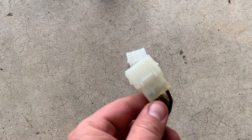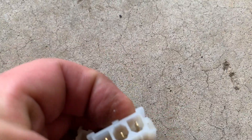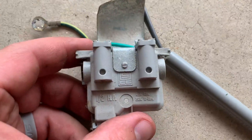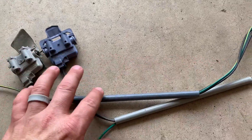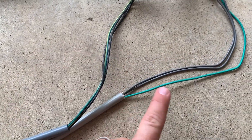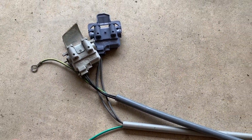Now I'm going to compare my original with the aftermarket one that I purchased. You can see we have three wires with a green in the middle on both of them, and the clips look the same. Down on the other end is simply a push switch — my old one's broken. Both say they're for a half horsepower, and it looks like the screw holes are in the same place, so it should go on pretty easily. One thing that is different is the length of the wiring — the new one came with a really long piece of plastic, so I pulled the wires out of it and cut it with a pair of kitchen scissors. The wires are a little bit longer but that shouldn't be a problem — I'll be able to hide them up in there or tie them up if I need to.